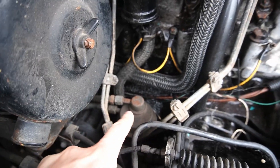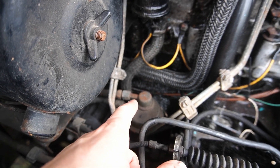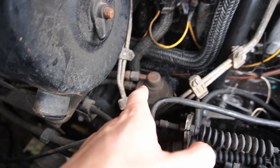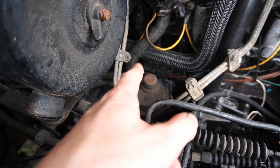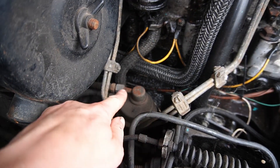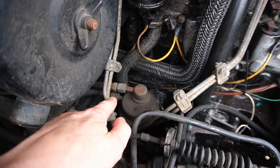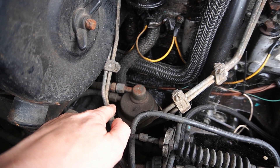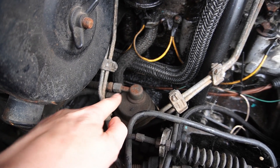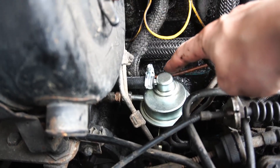This is the lift pump and I'm pretty sure this lift pump is dead. I have a spare one so we're going to throw it in and hope that it works, but they never really work that long anyway. One connection is fuel in and one is fuel out - we're going to put a hose on that and take it to the electric fuel pump we're wiring in. Through the power of editing, we'll just have this done. Got a new one in but it still doesn't lift the fuel out of the tank.